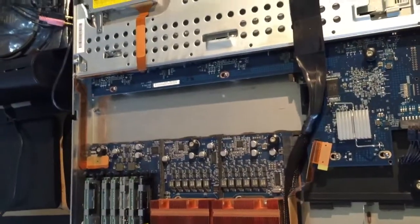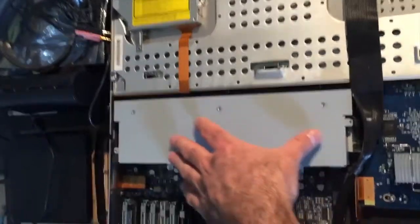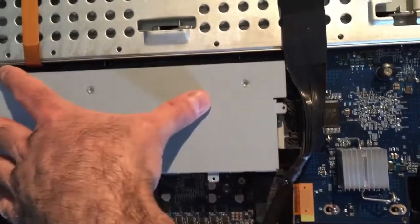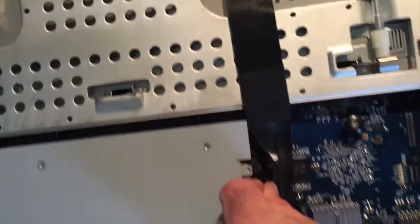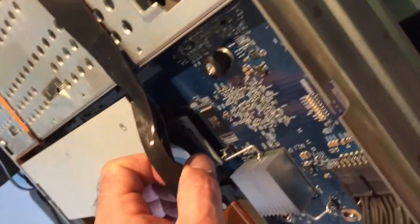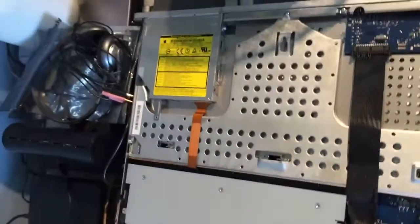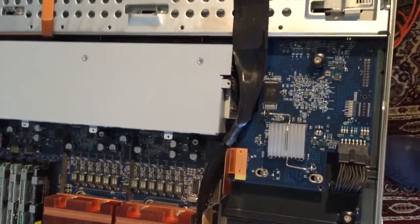Got the fan assembly back in. The key is to line up those holes — there's one screw down there and one screw right there. Line them up perfectly, slide the assembly into place, and tighten those screws down. The connector should reconnect; there's a little wiggle room but it does reconnect — that's what powers the fan array. Last but not least: put the vent cover back on, reconnect the power supplies, and fire it back up.